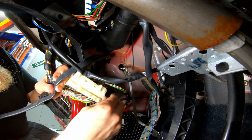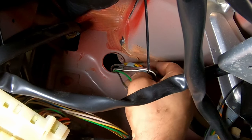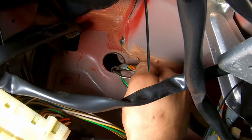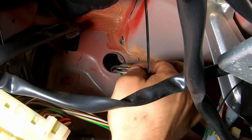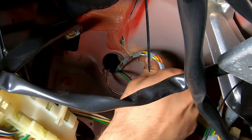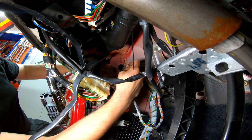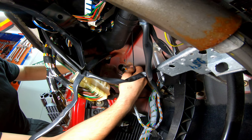Alright, so I've been doing some thinking and I've come to a conclusion. I'm color blind so don't kill me if I get this wrong, but this green one and this black one go to the side blinkers. This black and white one and the red and black one - I think these two go to the door opening sensor. And this bundle right here goes to the wipers - that is my theory. The only way to confirm it is to get to the wiper motor, so let's do that.